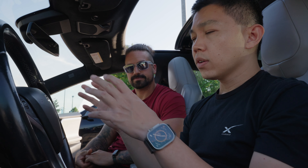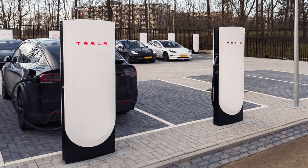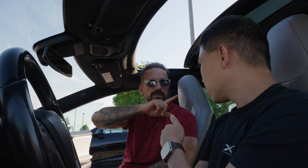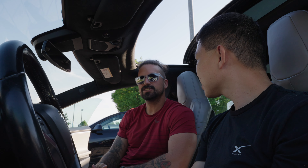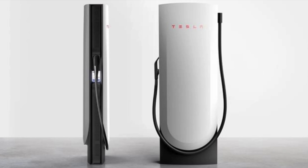So those are two good key messages from Max — for those who have been long-term Tesla owners, the build quality has improved and there will be fewer replacements, especially with the refreshed Model 3. And second, with the charging network, the V3 charging stations' cables aren't as long for some EVs where the charge port is in front or on the other side. So Tesla releasing the new V4 network has longer cables — about 30% longer. Have you been to any of those stations? Are those the white ones? Yes, the tall white ones. They are about 30% longer and meant for all kinds of EVs to use.